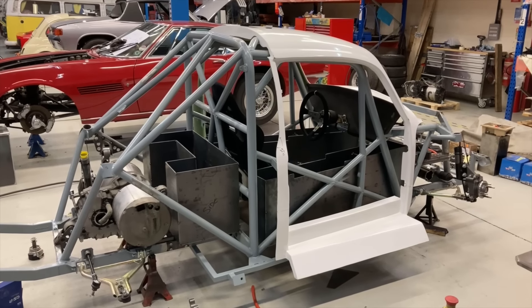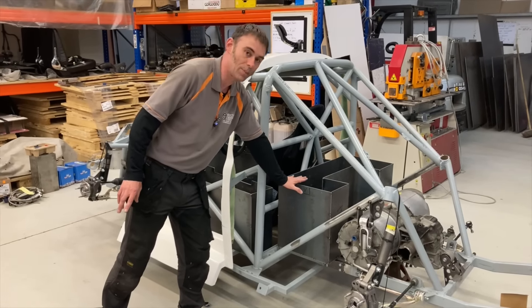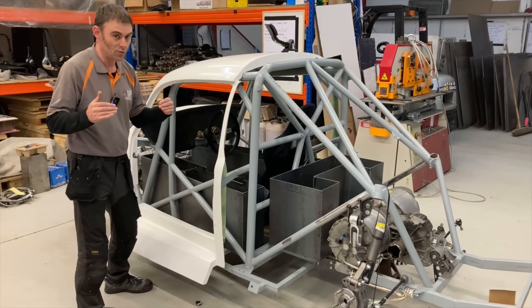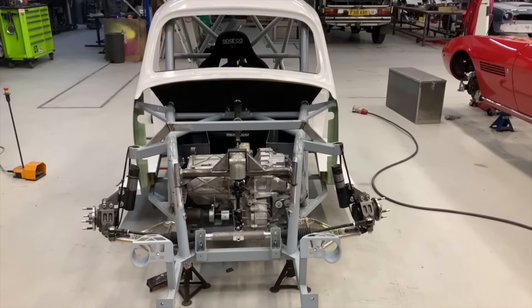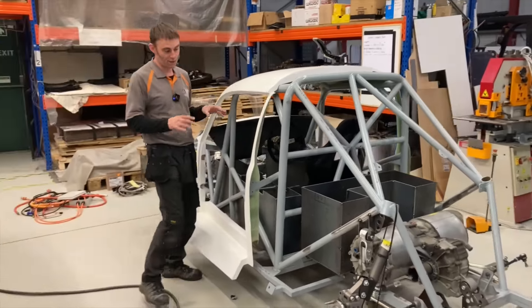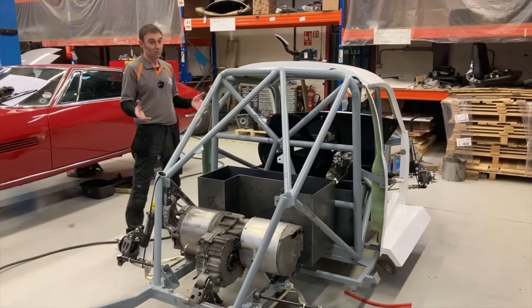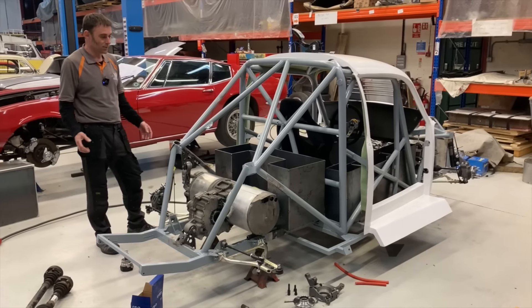We've got the battery packs roughly tacked together. We've got six LG Chem modules going in there, so that's going to be a 400-volt battery pack. There's another one here and another one on the other side. Because we're putting them in parallel they're all going to be sharing the load, which is needed — that motor alone can pull around 1,200 amps, plus there's a small Tesla drive unit in the front. With full throttle then brakes in racing, the amp draw from these batteries is going to be massive, and regenerative braking on top of that means paralleling them up is essential.